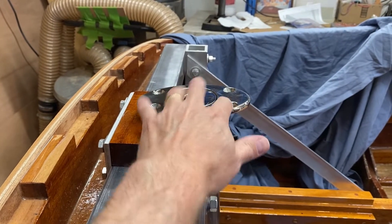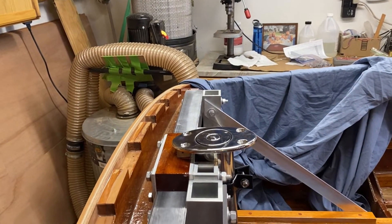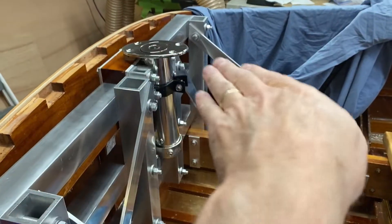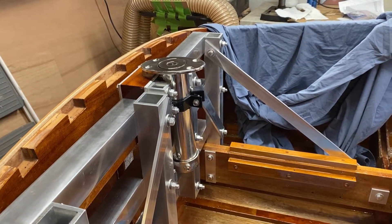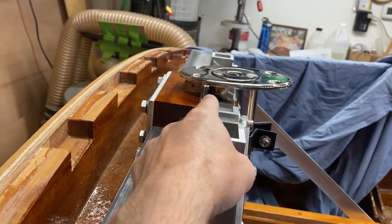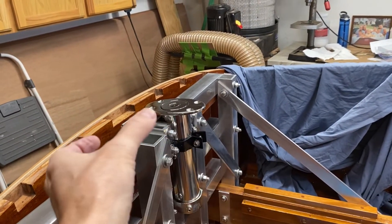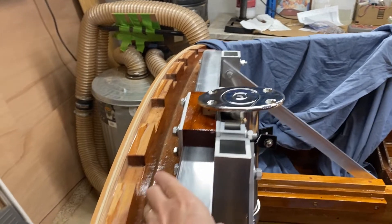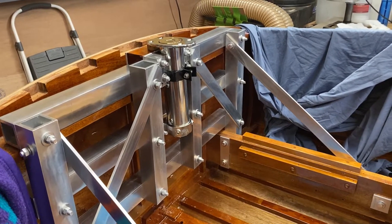Because I didn't want the top decking to take that back load — the intent was for screws to just screw into the deck — I knew that wouldn't be sufficient. I also didn't want any of that side load or back load, which will be the most of it, on just four deck screws. You really need something solid for the pylon to rest on, which is what this plate does, along with the wood and the back plate. Together, all those help secure it to the top structure.